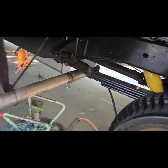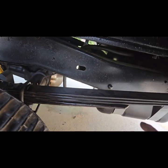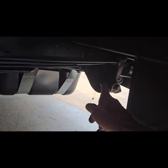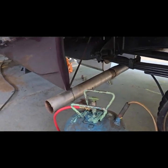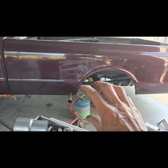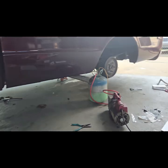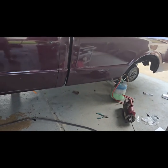I'm just using the pipes that I had. Instead of trying to go over this axle — between the third member, the shock, and then come around the gas tank, which is very tight, all of it's very tight — then you gotta go between the gas tank and the spring hanger, shackle hanger. It's just too tight. So I'm just gonna run it out the side. I haven't figured out exactly how far. I think that'll be pretty good. I was thinking maybe some turndowns, and then I seen some rectangular exhaust tips. I'm not sure exactly what to put there, but they're all expensive — like 30 or 40 bucks a tip. And I hate to spend 80 bucks on exhaust tips. I might have to.